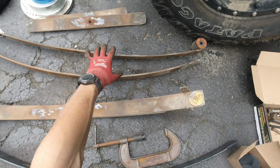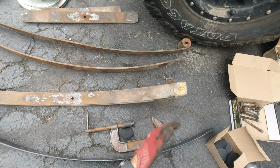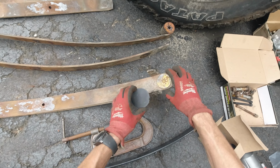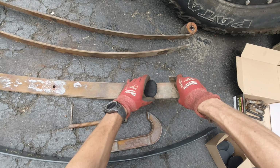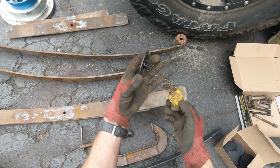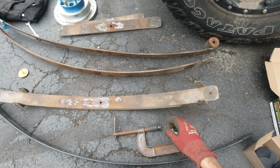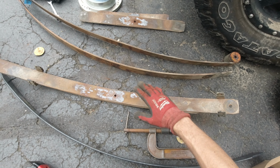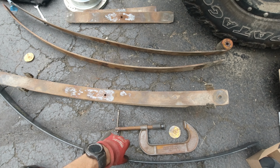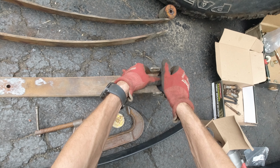So now we're disassembling the leaf pack. Just keep in mind which direction they go. Since we're disassembling the leaf pack, I'm also gonna be replacing these pads which have been recommended to me, because if you look at the ones that come in there, they're very thin and small, and I'm gonna be replacing them with these ones. I'm gonna leave the model number in the description. And another thing, as you disassemble this, just keep in mind which direction the leaf packs are going. It's very important. And then the new one's gonna go just in there, snap in there.